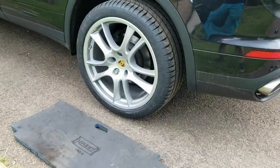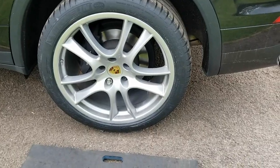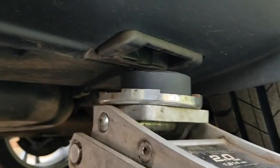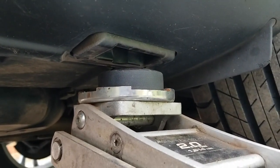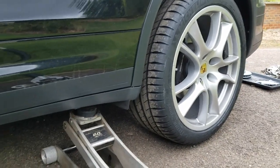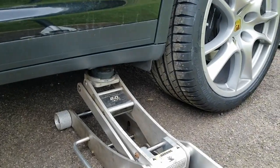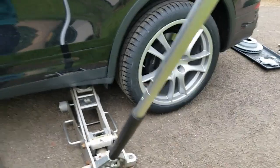So let's get on with taking the wheel off and I'll show you where the jacking points are. We're going to put the jack underneath the jacking point. I'm just using a hockey puck to protect the mount there. You can get special mounts that just fit in there, but the hockey puck is fine. Obviously the handbrake is off, and over there the wheel is chocked so that the car can't roll.